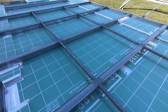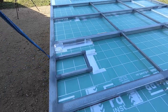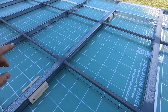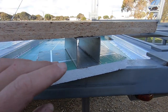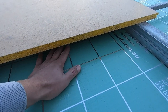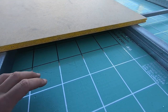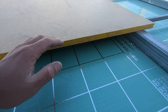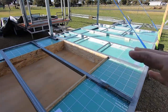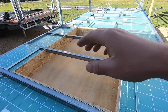Because it's foil, I can seal it up with aluminium tape, which provides a moisture barrier to the subfloor. I've attached the foil board to the trailer by fixing it to the underside of the ribs wherever possible. On the outer perimeters — where I have leveling stands and wheel wells — I've gone level with the bottom of the ribs and just on top of the chassis rail. Putting the foil board underneath the ribs gives me an air gap between the insulation and my floor, which dramatically improves the foil board's performance.